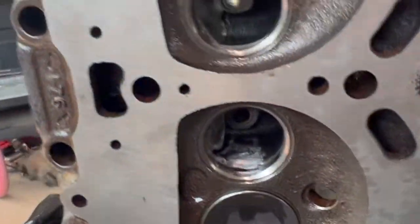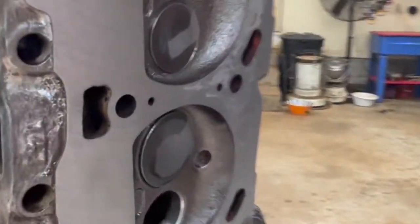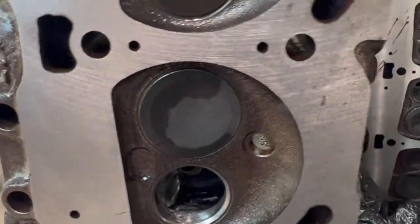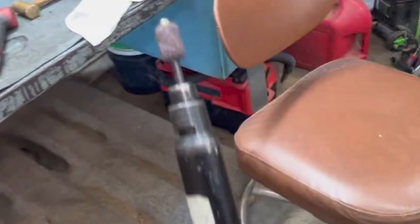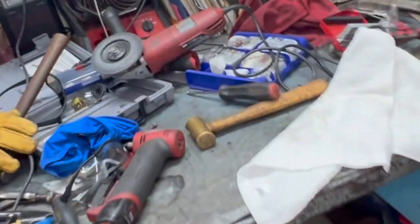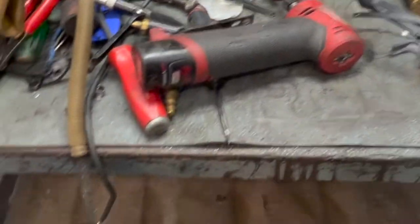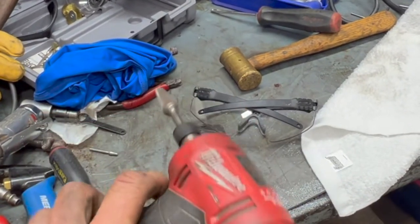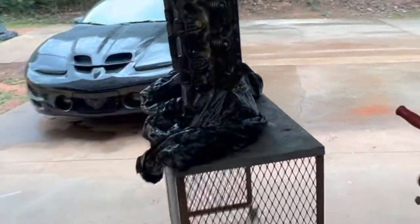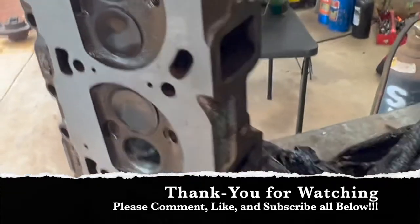Other than that, I'm super excited - first time doing port work and head work. I have metal shavings everywhere; hopefully the dogs don't run into that. I used an air dremel with a little sanding disc and a carbide bit on a Milwaukee. I was using air for a while on the grinder but my compressor started spitting water and it got annoying. I used those two tools to do all the port work and I did very well - pretty happy working on cast iron because it's pretty forgiving. Now let's get this all bagged back up and put it in the car and get ready to take it to the machine shop.